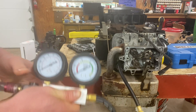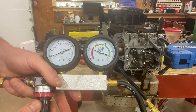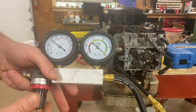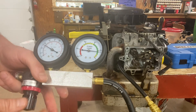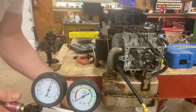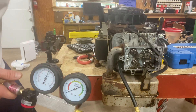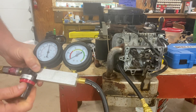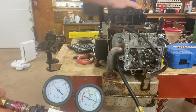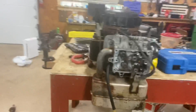So we're going to shove this in here and then crank it up — we're going to watch the pressure go up. Now a lot of people say to put a full 100 psi in there. You can see this thing's holding pretty good — I see very minimal leakage at 30 psi. Now when we crank it all the way up, I hear nothing coming out of there. There is some air coming out of this intake and a little bit there, but as you can see it's really within range when you've got 30 psi in there. So we're going to move on — I'm going to try one more thing on why this thing might be leaking.